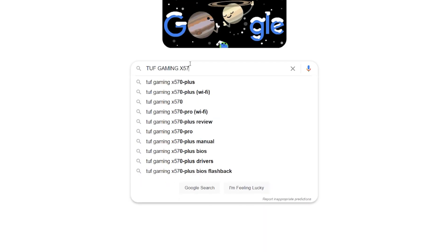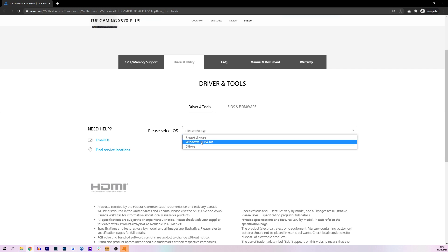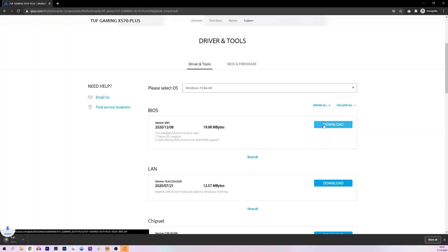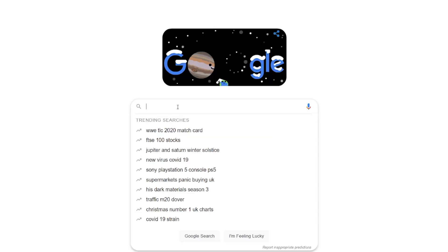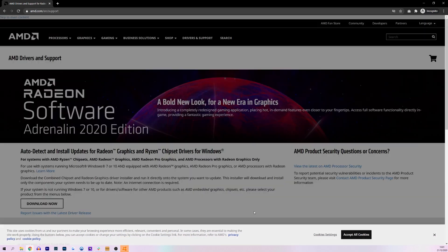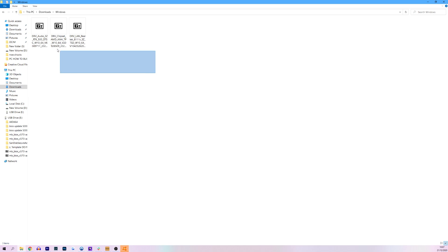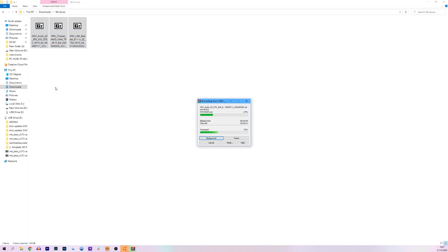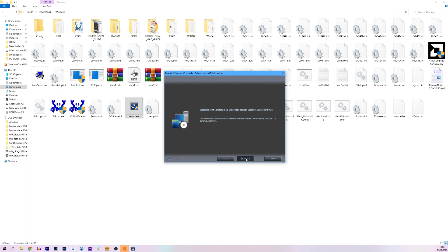Now you need to download your drivers, starting with the motherboard driver. Search for your motherboard on the internet, click on the manufacturer website, and click on support. Go to drivers and select the operating system you are using. Download the system and chipset drivers, the audio drivers, and the LAN drivers. If your motherboard has Bluetooth and Wi-Fi connectivity, make sure you download those too. For the GPU driver: if you're using an AMD GPU, go to the AMD website, click on the drivers and support tab, select your graphics card, and click download now. For NVIDIA GPUs, go to the NVIDIA website and install GeForce Experience — I'll put links to both websites in the description. To install your drivers, go to the downloads folder, extract the zip files, find the setup.exe file, and follow the on-screen instructions to install. Do this for all the driver files.